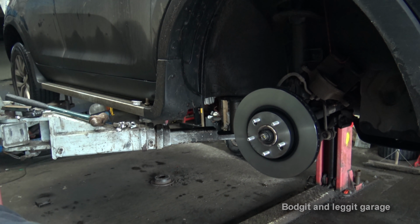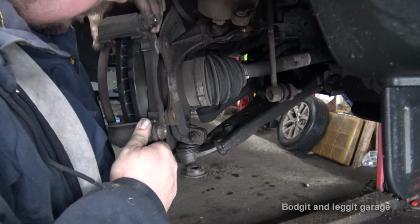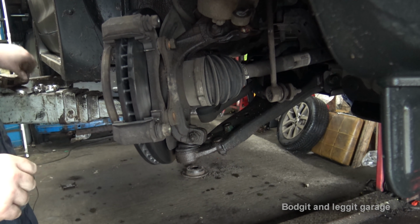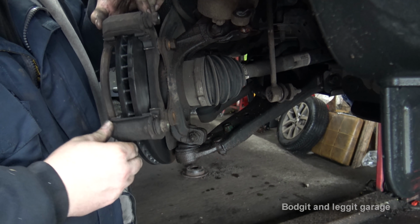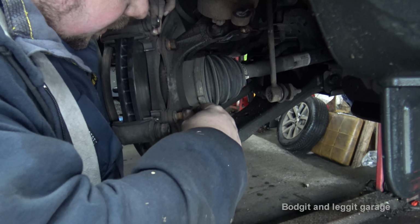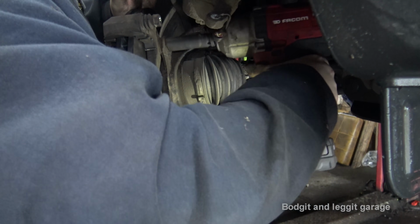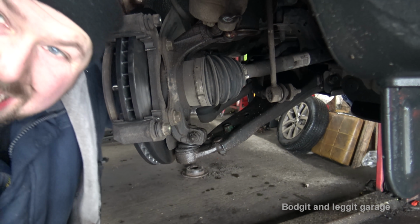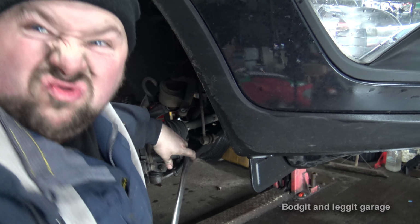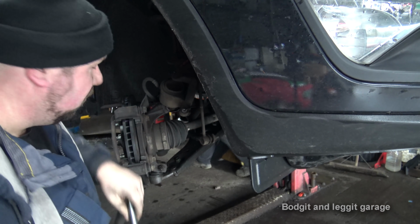Now we can put our freshly cleaned carrier back on. Cleaned it all, re-greased it, ready to go back on. Right, we can put the carrier back on. Same thing again, get both bolts, don't just tighten one, because if you tighten one and this isn't completely in the right place, you're not going to get the other bolt on. Not only that, you can even damage the threads trying to put it on. Then you're going to have to get a new carrier, and it just gets expensive. And for those who watch my channel, we're going to tighten this to a medium to strong grunt. Sorted. And there we go. Sorted.